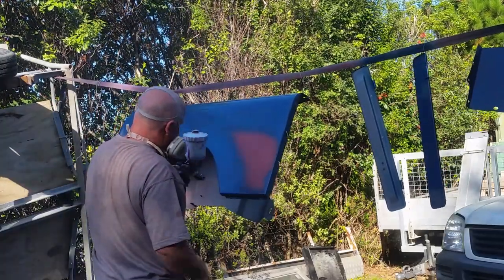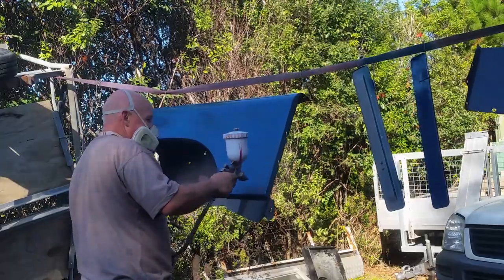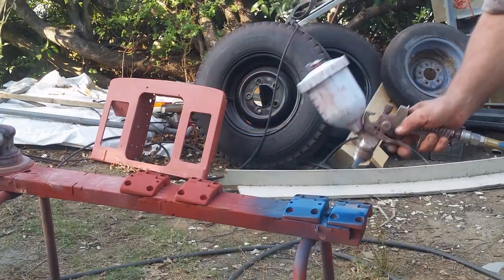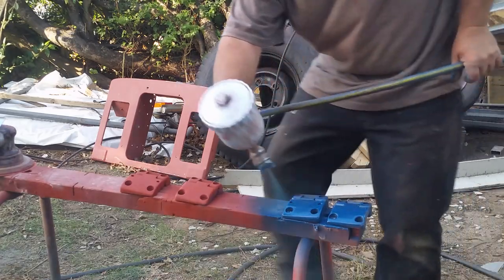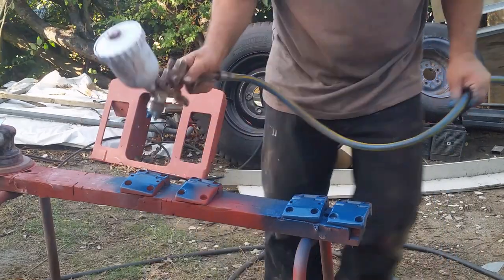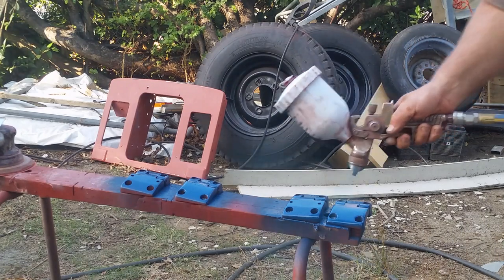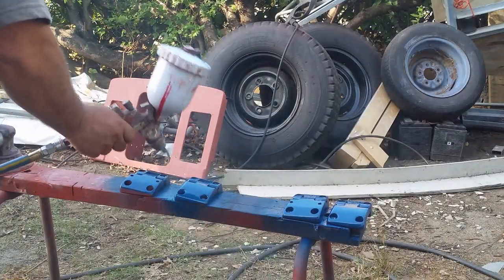The painting method for two-pot paints is called wet on wet. How you're supposed to do it is: one wet coat, leave it five minutes to tack off, and then one more wet coat over the top — and that's it. I'm using a fast hardener because I've got a dust problem working outside, so I want the paint to dry as quickly as possible. That means it won't flow out and give an absolutely glass-like finish, but that's okay — I'll have a slightly muffled but very very shiny finish that's going to be incredibly durable, and I won't have any dust in it.